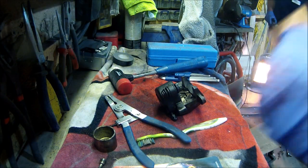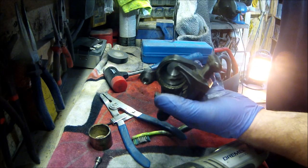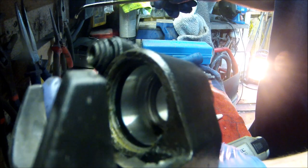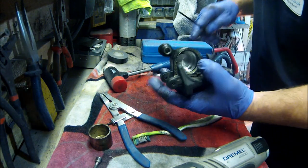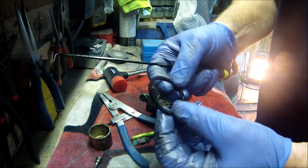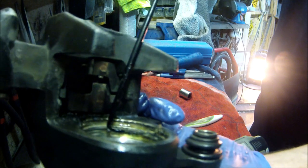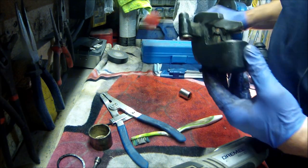Let's get a pick. There's a load of crap in that first lip there. You'll have to dig it out. Loads of it - horrifying. I'll get the other seal out. It's got some gravelly bits around it. There's even greenery in there - even some greenery. Plant life in your back caliper - you really don't want that. It's not conducive to the best brake performance.